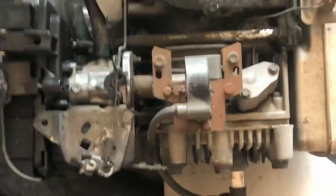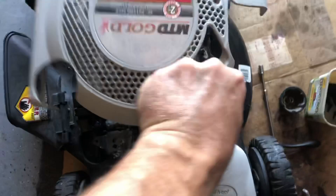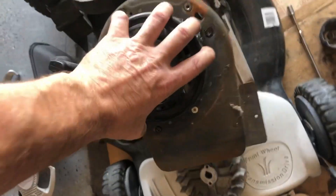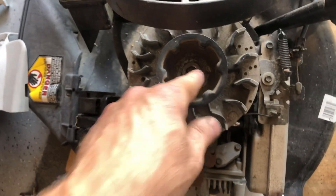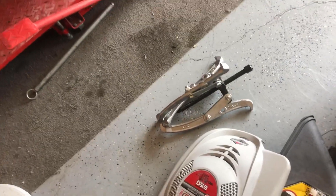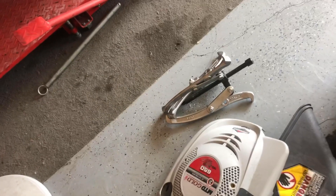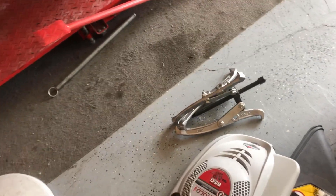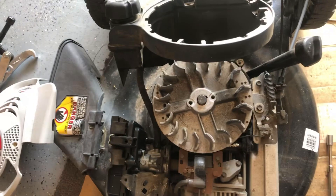In order to get these off, you need to take off the top engine cover however yours comes off. Sometimes other items like the fuel tank have to come off too. Then you have to remove your pull start cover — this one was held on with about four or five bolts. There is usually a large nut of some sort that comes off, and you will need a two- or three-jaw puller, three-jaw preferred. You can pick one up at an auto parts store or Harbor Freight for about 15 bucks. Basically, hand tools and a little bit of knowledge.